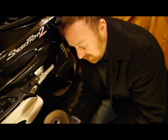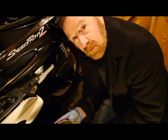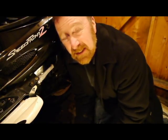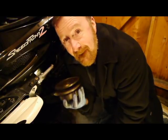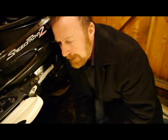Very happy I took that off - the rollers were crap and this clutch was crap too. So guys, if your bike is doing a decent speed but takes ages to get there, takes ages to pull away, and you lose speed up every single incline - clutch, rollers and belt. Said it all along in every video.